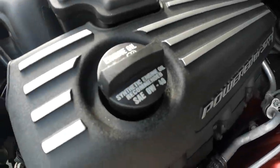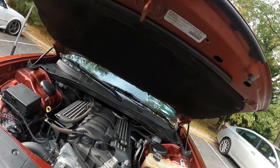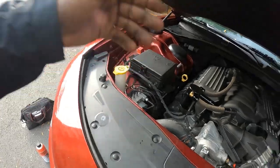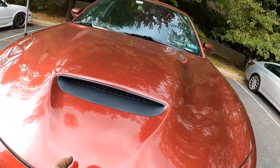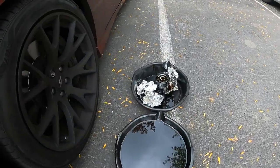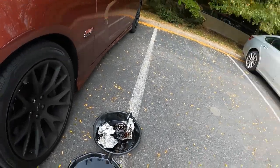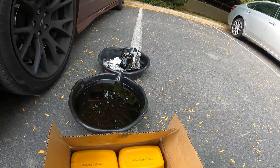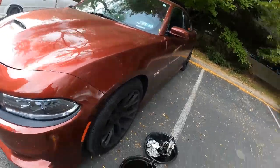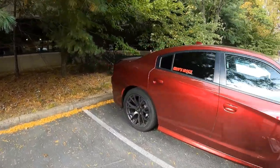Make sure you check it, make sure you got everything the car needs. You can let it run for a little bit, let it get warm, then turn it off, let it chill, and check it again. Make sure your coolant is good, make sure your window washer fluid is good — everything. You can dispose all the old oil at your local auto parts store. I go to AutoZone. You don't want to leave it around any pets — it can make them sick. Find your local AutoZone or O'Reilly's and dispose of it there. Don't just pour it anywhere. Clean up all your stuff and she's good to go.